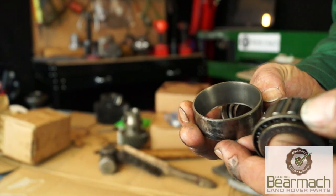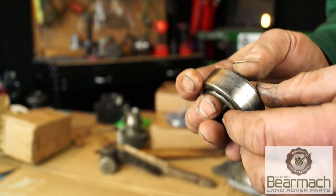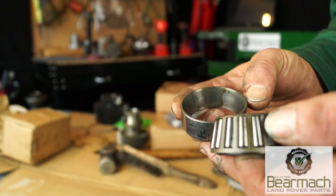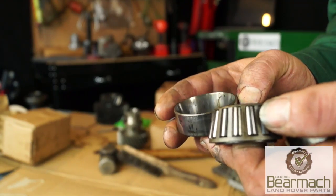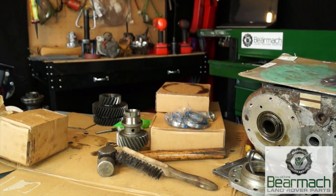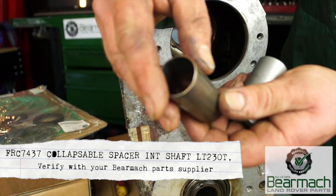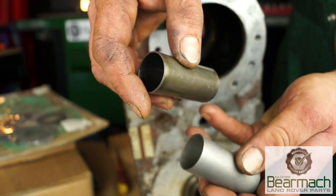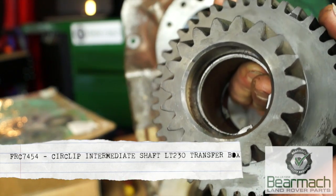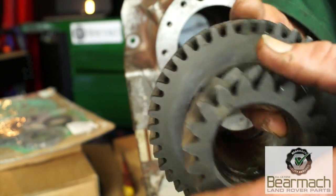The bearing races have been knocked out — they're worn. The shine has come off them and on this bearing you can see a little bit of marking. At the price of them it's worth replacing anyway. You can buy the bearings separately from a bearing supplier; they will have numbers on them. This is the collapsible spacer — it's quite a thin piece of metal and it's a one-use-only component, so chuck it away and put a new one in. Bearing race stops are circlips — there's one either end, and it's highly recommended that they are replaced when you change the bearings.